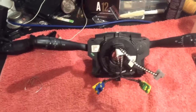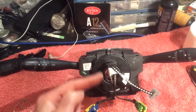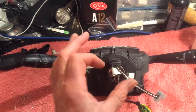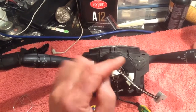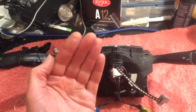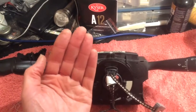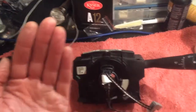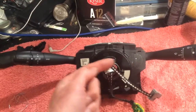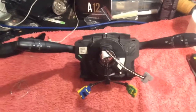Here's a wee trick. When you go to take the steering wheel off, there's a large bolt in the middle. Loosen that up but don't take it all the way out. I did, and that was a dumb mistake. These wires are sitting through the steering wheel, and as you go to add enough force to pop that steering wheel off, when it finally does come off, it will nearly hit you in the face.